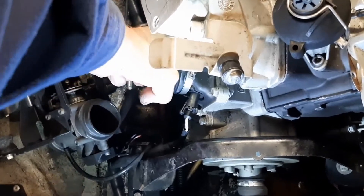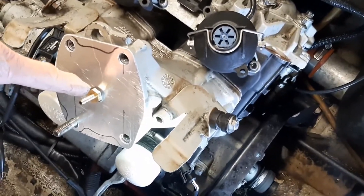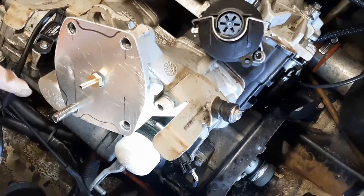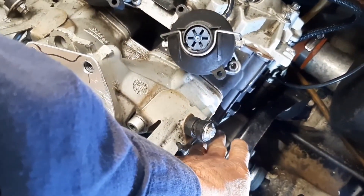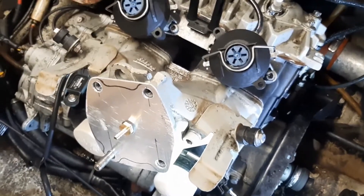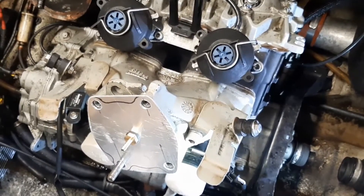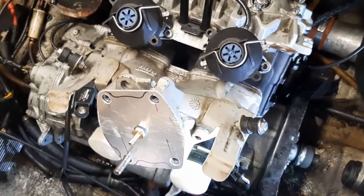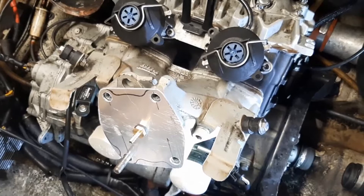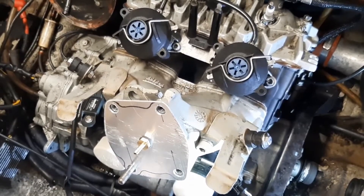You can tighten the clamps and that'll give you a good tight seal. Once we do that, we'll apply air pressure here — you could do it through one of these intake caps. That'll pressurize the cylinders and the crankcases, and you'll watch for the pressure to hold steady. If it leaks down, you've got a leak somewhere, and the only place that leak could be is in the crankcase seals. The pressure for this test is low — you don't want to blow out the seals. The manual calls for five psi. I'll show you my rig for hooking up the air pressure.